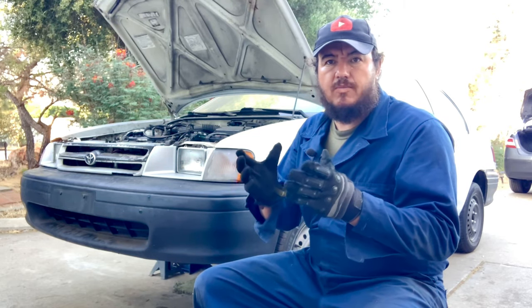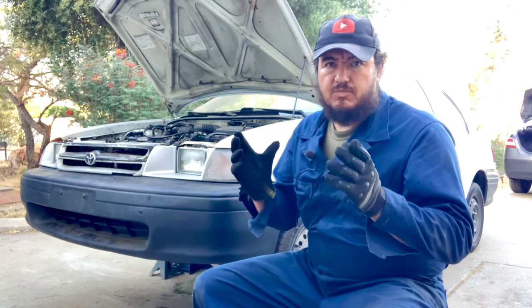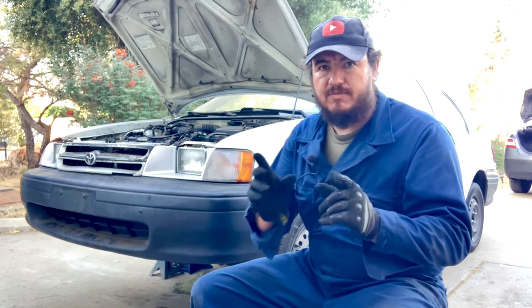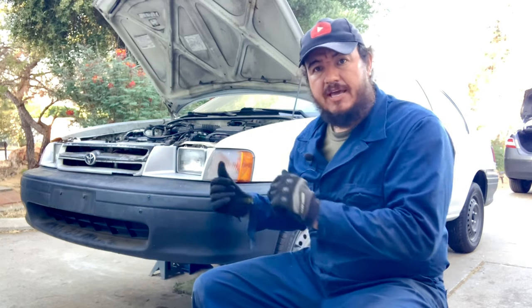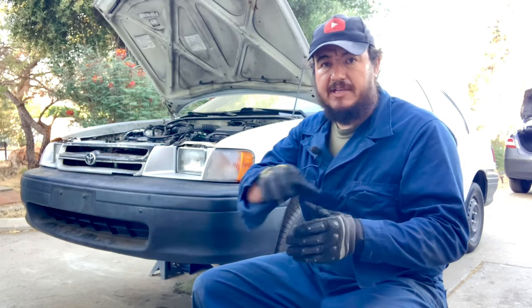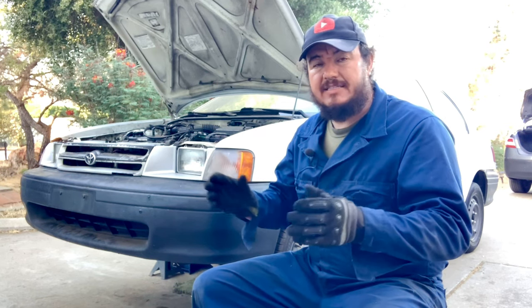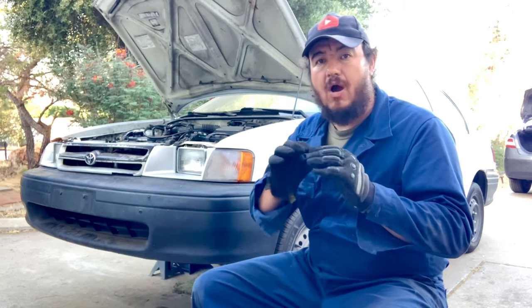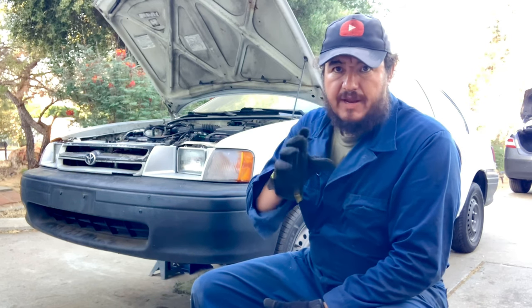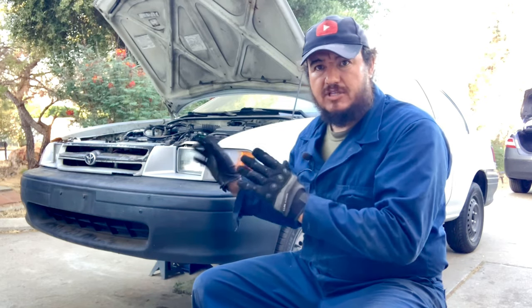Hopefully this video gives you an idea of how to replace the oil pan gasket on a '91 to '99 Toyota Tercel or '92 to '99 Toyota Paseo. It's pretty straightforward. The first thing is to make sure you have the right parts before you start the job so your car can stay on the road while it's still leaking a little. Also, surface preparation is critical — how well you clean the surfaces determines how long the gasket will last.